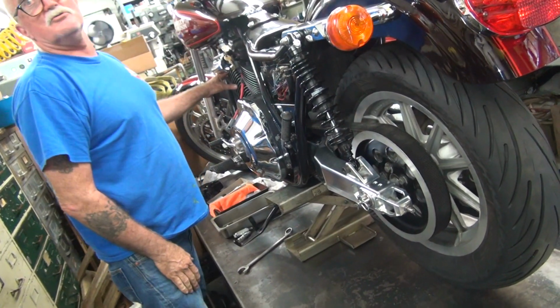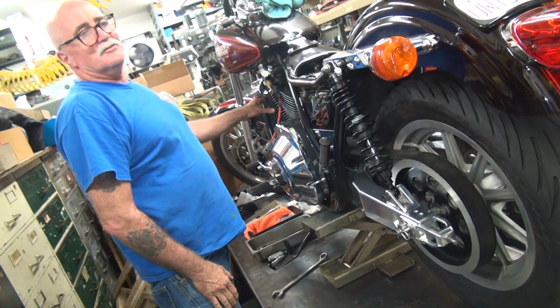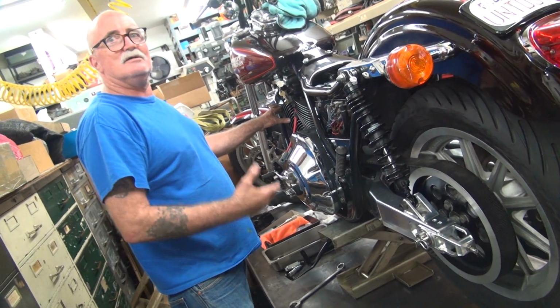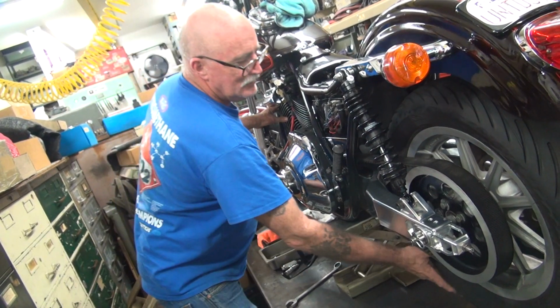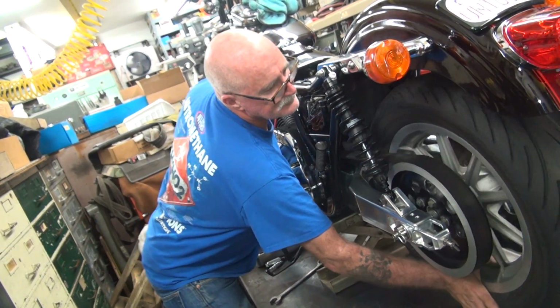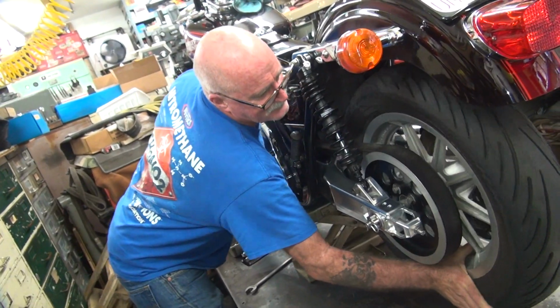Well, going top dead center, going backwards? Does the crank go both directions? Yeah, I just feel like it's sucking right now. Well, if you're sucking, you're going the wrong way. What if I pass it up and want to go back? If you're sucking, you're going down. Are you trying to get bottom dead center or top dead center? Well, then, if you're sucking, go the other way. Yeah, see, that was a blow. Now you're sucking. Well, then go back the other way. Between suck and blow is the high spot.